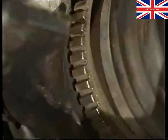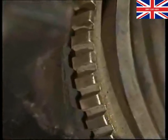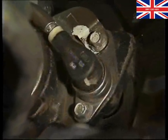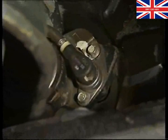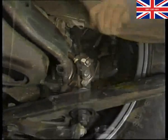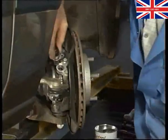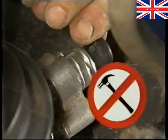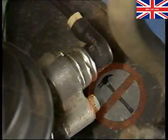The pulsar rings are fitted to the drive shaft of each front wheel and also to the drive flange of each rear wheel. Adjacent to each of the pulsar rings is a speed sensor. These are fitted to a clean surface with the sensor bodies coated in lead-free grease. They must always be fully fitted without force before being secured.